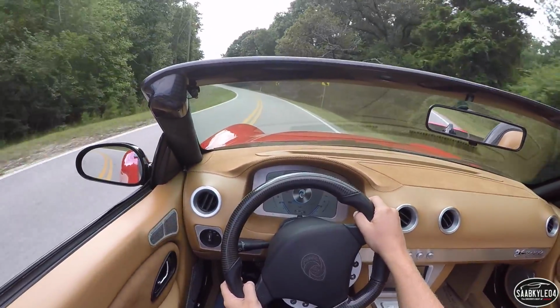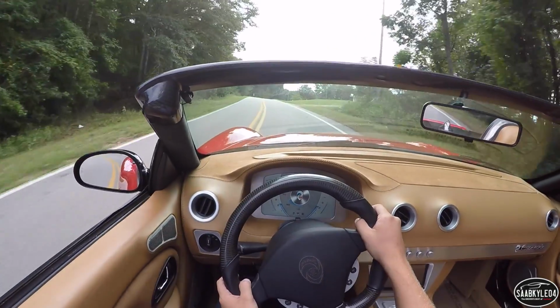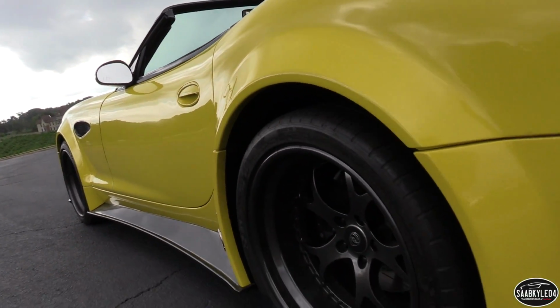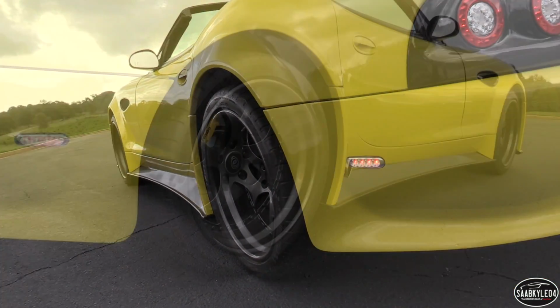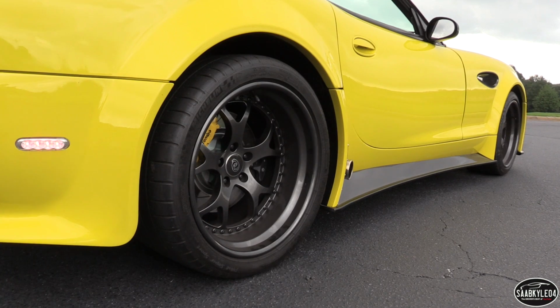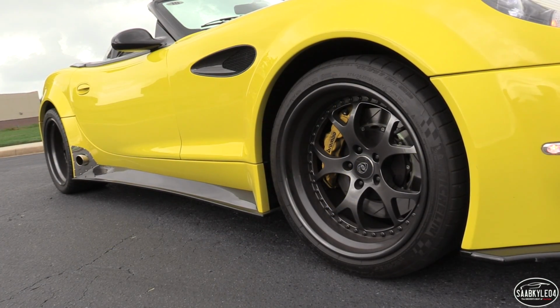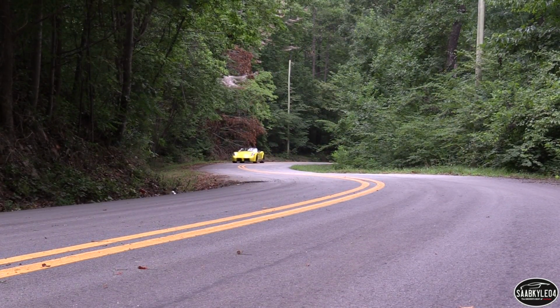Two-piece forged aluminum BBS RS-GT wheels come standard on the Spyder GT, although they're not shown here. Regardless, on the Spyder GT, the wheels measure 19 by 10 inches in front, paired to 275/35 tires, and 19 by 12 inches in the rear with 325/30 tires. An ultra-lightweight BBS F1 wheel package is also available for reduced unsprung weight.